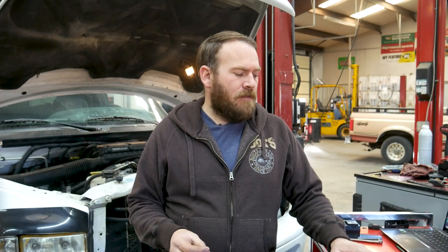We're not going to go all the way back to points because I don't have a test vehicle that's easy for me to access. So we're going to go with a basic V8 truck with a distributor with an external coil, and we're going to start out with just the primary test. We're not going to go into the spark plug leads yet — we're just going to look at the ignition primary.